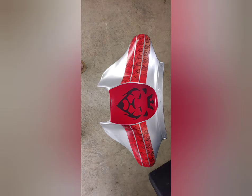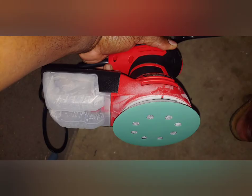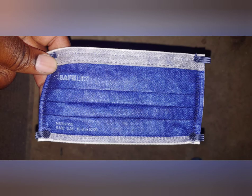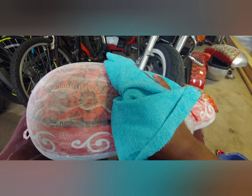Once you get your parts together, move on to the next phase. If your paint is in good condition, you do not have to strip. Just get a soapy bucket of water and some 800 grit sandpaper - actually you can get 400 or an orbital sander. Make sure you have a good dust mask so you can start sanding. You can do it by hand without an orbital sander, but it's a little work.